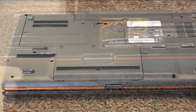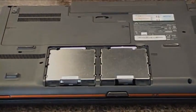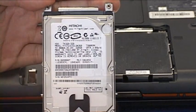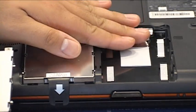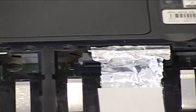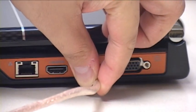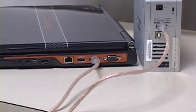Like other notebooks in the P-series line, the 7801 has two bays for 2.5-inch SATA 2 hard drives. Gateway includes a single 320GB 7200RPM SATA drive, but they also give you the caddy for adding a second internal drive. You can use this second drive to simply add storage, or, if you desire truly insane transfer rates, you can run the 7801U in RAID 0, striping the drives and boosting transfer rates by up to 70%. The eSATA connector also gives you the option of a super high-speed link to massive amounts of external storage.